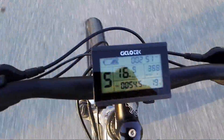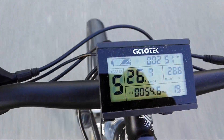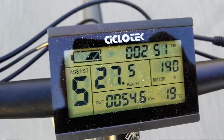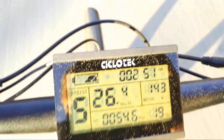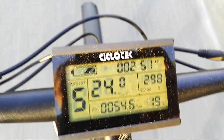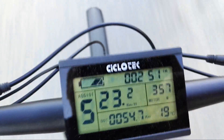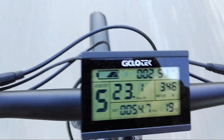Let's try one more time here — this is just ever so slightly uphill now. You can see that as the speed gets close to 30 kilometers an hour, the motor output goes down. It's somewhere around 100 watts now with the battery just half full. So this is probably about as fast as we can go with motor only.